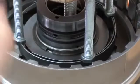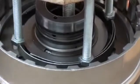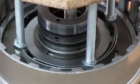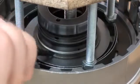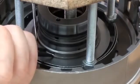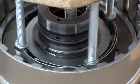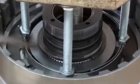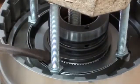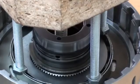So let's compress this down. Now once it's compressed, I can get my circlip pliers in here, run my pick tool around, and lift that up over the top. Once that's over the top, it's actually quite a simple process of just getting a screwdriver on here, give it a twist, and as you can see that's just popped off quite nicely.